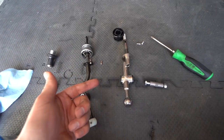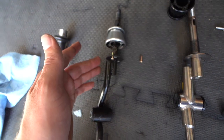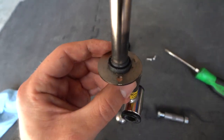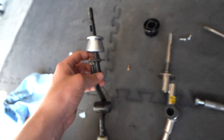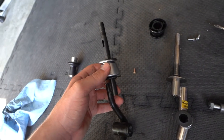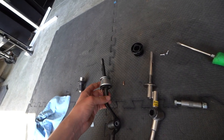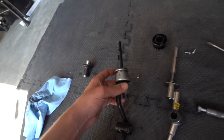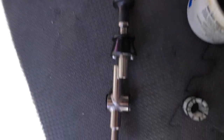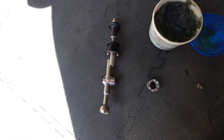Normally, if you're installing this on your STI, you're supposed to disassemble and take out this little O-ring here — you can see it's freaking filthy on my stock one. Like I said, I did get this shifter used, so it already has the little O-ring swapped over that you need to put inside there. There's just two screws in the bottom holding this guy on. It sets the height for the reverse lockout. I'm going to go ahead and put this thing back on — we're ready to go.